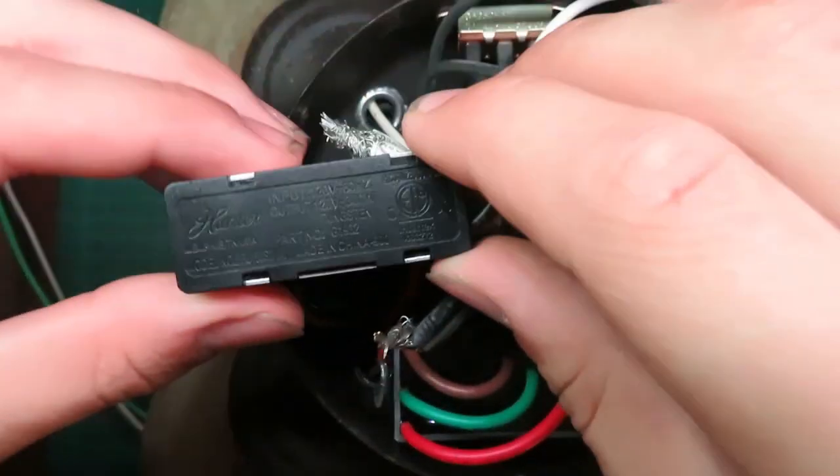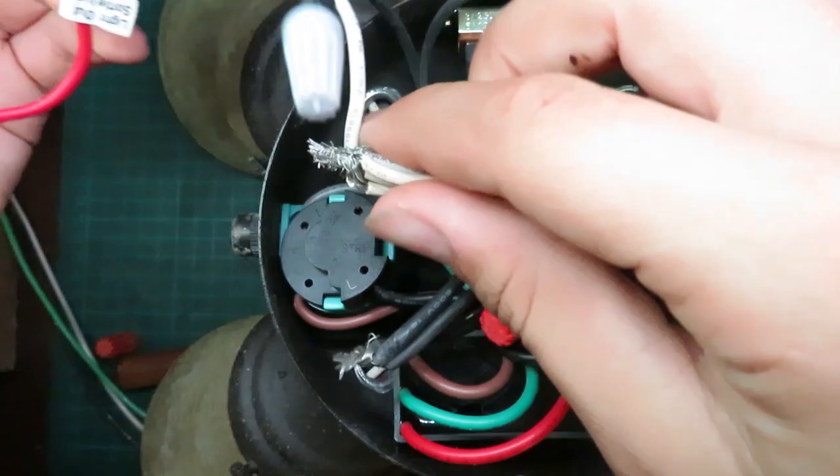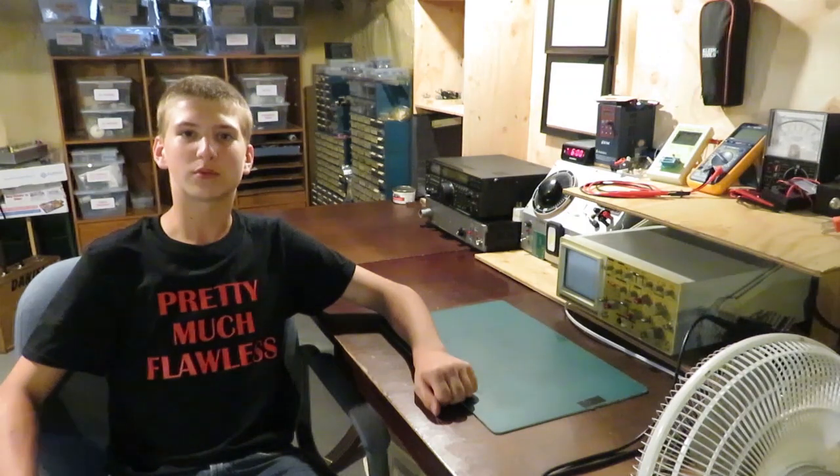We're pretty confident that it's this right here — the wattage limiter. So we will disconnect this from the circuit. Now, is Pretty Much Flawless removing a safety feature? Let's give some explanation. That component is just for limiting the wattage if you have too many high-wattage light bulbs. These are 6-watt bulbs, each one of them. As long as we always put the exact same 6-watt style bulbs back, we'll be fine. Maybe in a future video we'll try to fix the wattage limiter itself. Also, if you're going to try this on your fan, you'll probably want to consult your local electrician, as codes may vary from place to place.